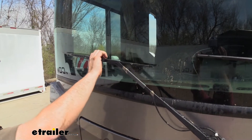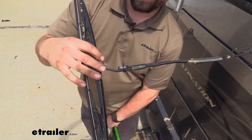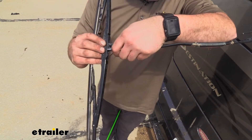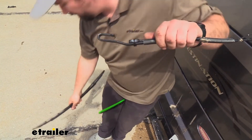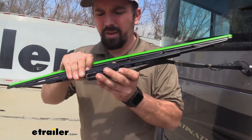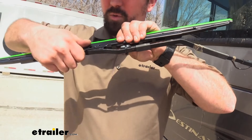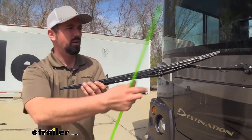Let's swap this one out — it's going to be pretty easy. We'll just swing our arm out. You also want to make sure that you do have the J style because that's what these blades are — there are a bunch of different options for the hook or attachment point. Try to stand on this side because if it flings back on your glass it can shatter it. You just push on the tab and then slide this out and pull the old one off. Putting our new one in place is very easy as well — we'll slide in the J-style hook and it will clip in, spread that out and it should lock in place. Give it a quick tug to make sure you're locked in, then slide the cover off and place this on our window.